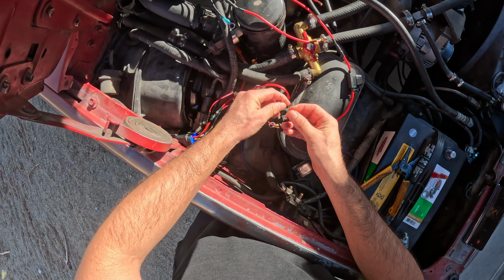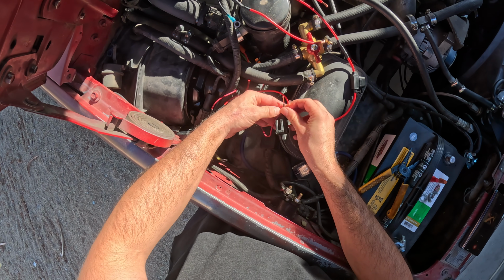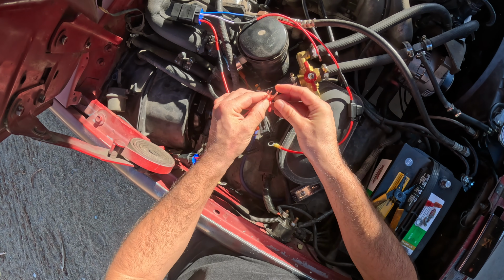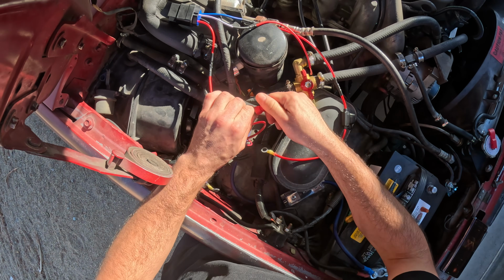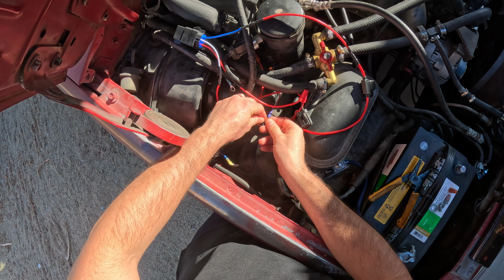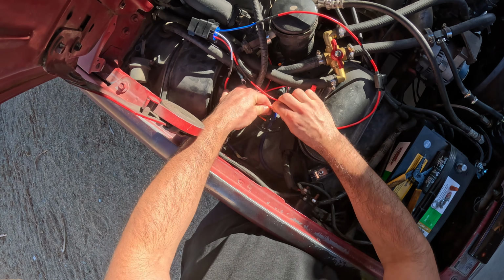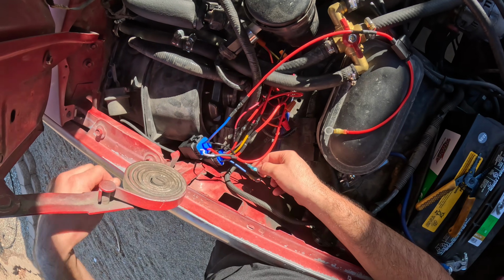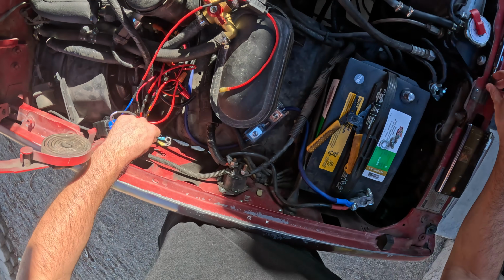We'll take the plug wire, the positive wire we used for our tap on the other relay, and our red wire from our new voltage relay, and get those all wire nutted together. Now we can get our white relay activator wire and connect that to the positive wire coming from the cab that we just cut off the plug. Now we can take the black ring terminal wire and we can get that mounted in the same area we have our other relay.